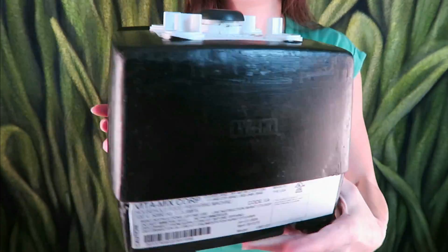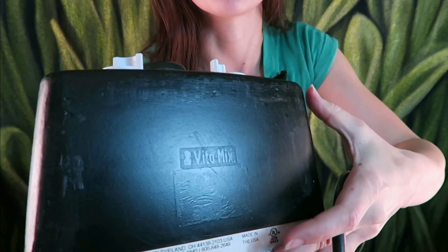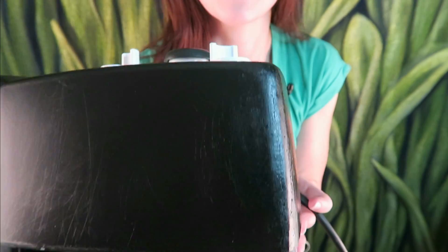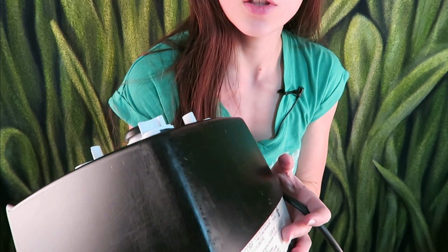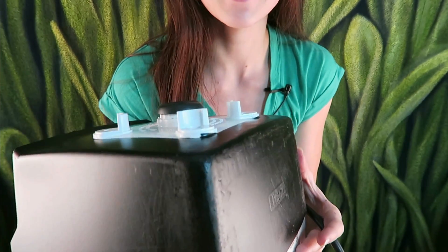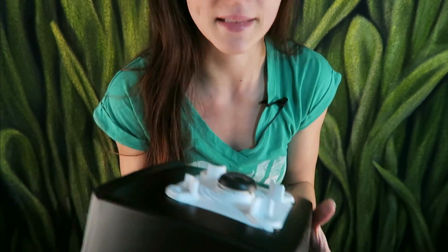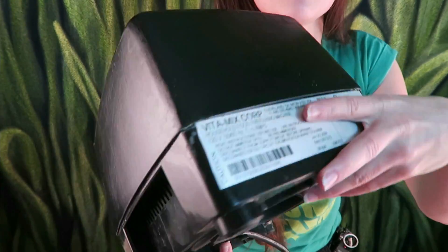Look at my blender — it's amazing! Or, you know, functional. It's obviously not perfect; I definitely didn't get it as smooth as I would have liked. But that's all the time I have to spend on this, and it was really interesting to work on an actual product for trying out that welder. It's more difficult than I expected to get the welding plastic to mix in with the parent plastic. If you don't actually melt the two plastics together, as you sand down you run into cracks and gaps and the weld is not actually bonded to the piece. Instead of spending even more time on it, I just painted it black so it's going to blend in with my parents' countertops.